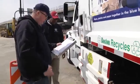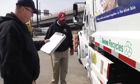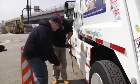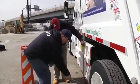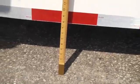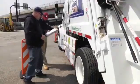The lowest edge of the lateral protection device is not more than 21.5 inches above the ground. This edge right here is not more than 21 inches. As we can see from the measuring stick, it's well within the legal limits, so that would pass.